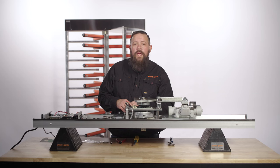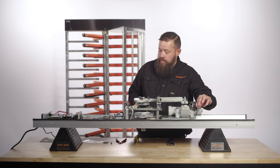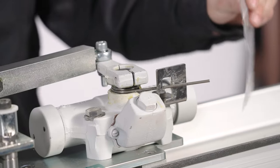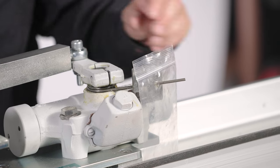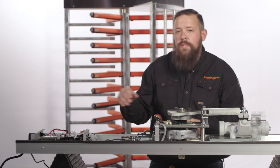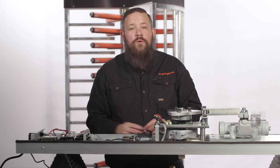Changing from fail lock would be the reversal of the previous steps. These new turnstiles will come with that spring inside a baggie, typically located right here. The last thing we need to do is power on the unit and test for operation.